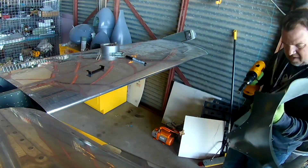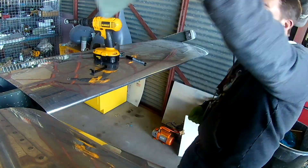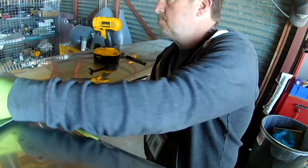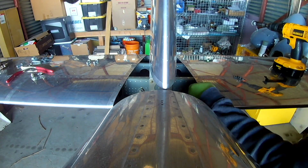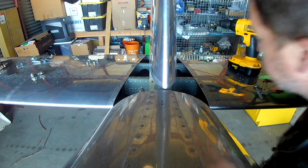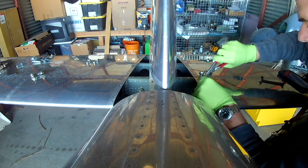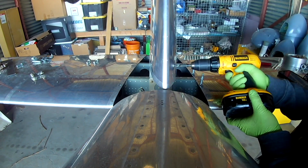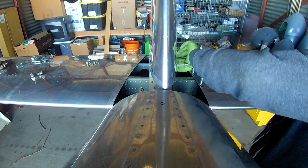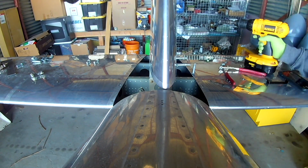Some people have been asking about the oil leak — what happened when you started up the engine? The Airwolf remote oil filter has been known to have some issues with leaking. There are two reasons why it might leak. One is that the two ports coming off the back of the engine housing are both AN fittings — double AN fittings — specifically 45-degree AN fittings on both sides. Normally 99% of fittings we deal with as builders are NPT on one side and AN on the other, but these are both AN.